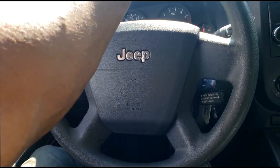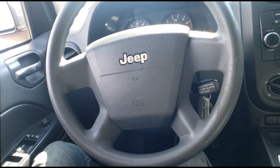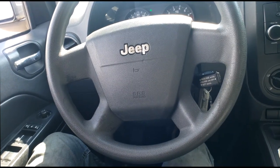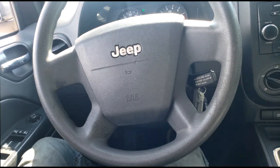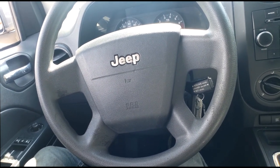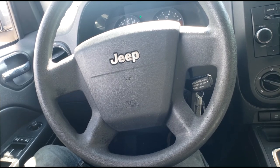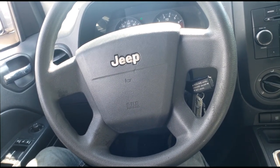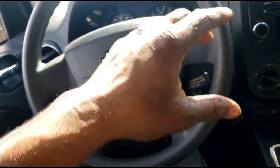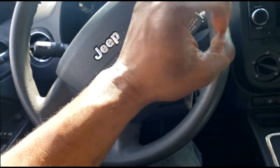So you basically need to get the car off the ground and do your typical wheel hub bearing check. You know - grab the wheel at the 12 o'clock and 6 o'clock position, push in and out, see if you feel any play. The 3 and the 9 o'clock position - you're basically testing for suspension parts like tie rods or rack and pinion and things like that. That 6 o'clock and 12 o'clock position test is trying to yield loose hub bearing results.